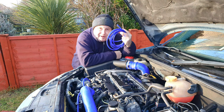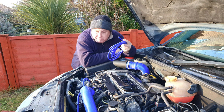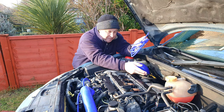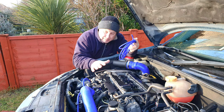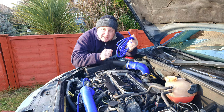I suggest you use blue vacuum hose, not just because it looks pretty under the bonnet and maybe even matches the colour of your car, but because the original vacuum hoses are all black and if you replace them with blue then you can see at a glance which ones you've done and which ones you haven't, so you reduce the risk of getting mixed up.